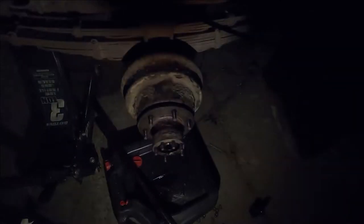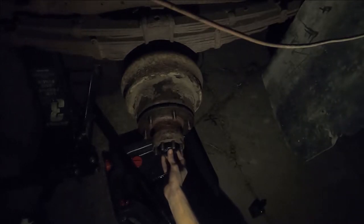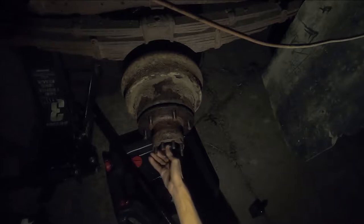I was racing all over town looking for an axle nut socket of 2 9/16 size. Every place I went to, it's like, oh, that's pretty big. Wouldn't have anything like that. But I did find this. This is an oil filter thing. It's 64 millimeters. It's 1 millimeter too small. But we may be able to get it on there. Come on. You know you want to be 65 millimeters, not 64. Seemed like a good plan.